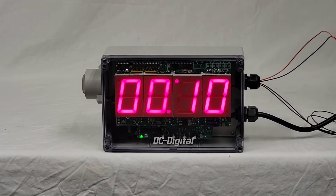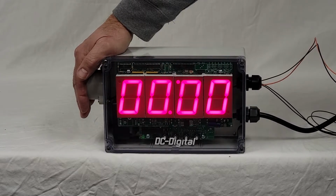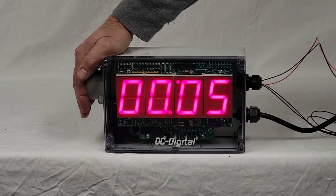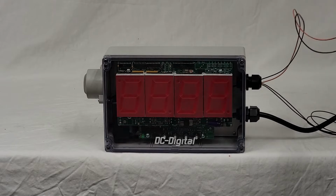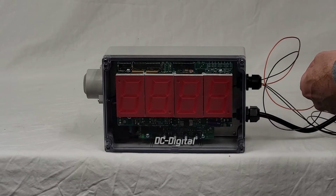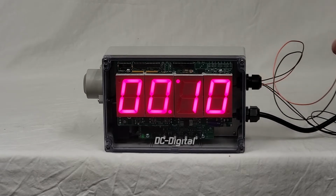And so what I'm going to do is go ahead and simulate. Okay, so they put the pastries in or whatever, and then they close the door, and then this is going to sound here for 2 seconds. And then giving indication that it has gone past the baking time, it flashes and starts to count back up. I'm still holding the door switch, just simulating that the door is closed. And I'm going to go ahead and release the door switch, indicating that they got the door open and they took out the pastries or whatnot.